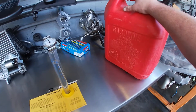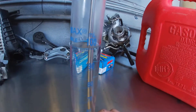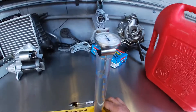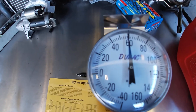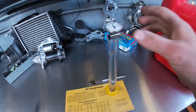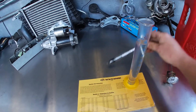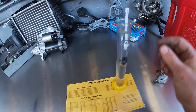I've taken a large sample of fuel to do the test. First I need to get 100 milliliters of fuel in my test beaker, then go off the temperature we're at — roughly 60 degrees, plus or minus a couple of degrees — so we're going to be going off this middle line of the chart right here. Then we're going to remove the thermometer and put in our hydrometer, which will measure specific gravity.